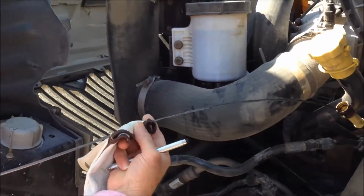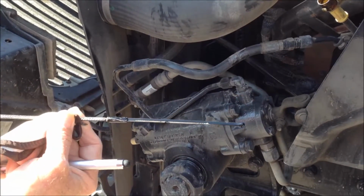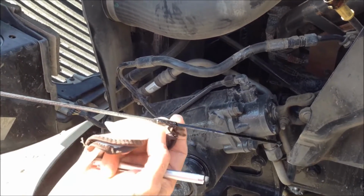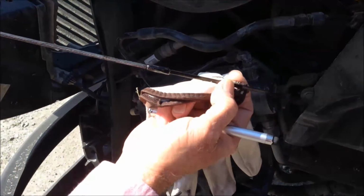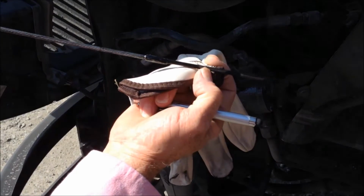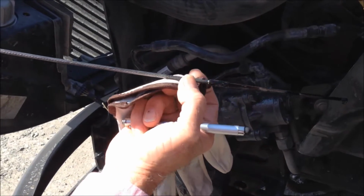Make sure our oil is all good. A very key important part: make sure the oil is full, which this one has 2 marks on it, which the full mark is actually there. It is not the mark on the top. A lot of people will confuse that and overfill and consume a lot of oil.